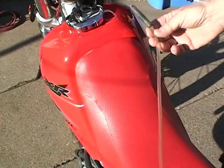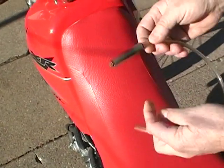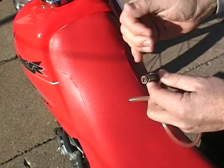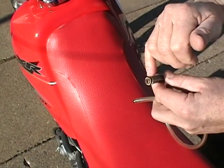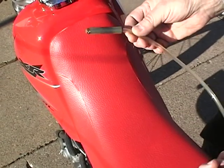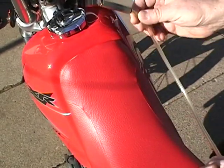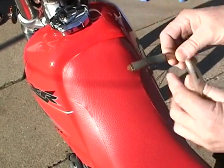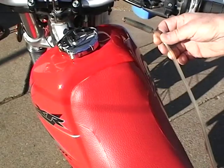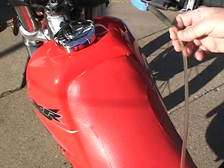What I have is a 21-inch piece of plastic tubing, three-sixteenths of an inch inside diameter, with a piece of copper tubing on one end to give it some weight. I've drilled a hole through both the plastic and copper tubing and pinned them with a small piece of copper wire. I'm using copper for both the weight and the pin because it's going inside a steel tank — copper is non-ferrous and won't spark if it slaps around. The extra plastic wrap is just to prevent noise while riding. The weight holds it down inside the tank, and it works pretty well.